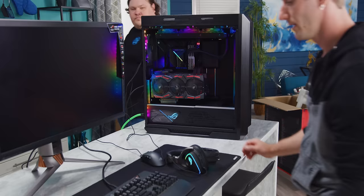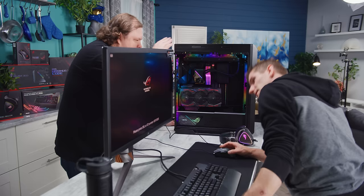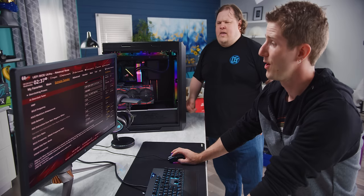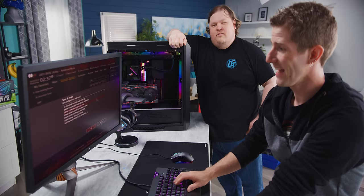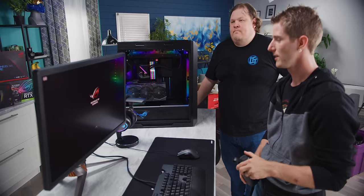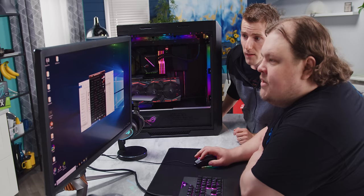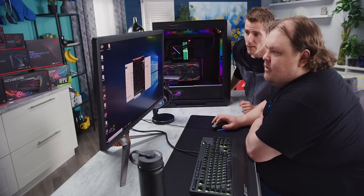Wish me luck — and we're up. The BIOS is prompting us about enhancing system performance with XMP settings. We turn on XMP, multi-core enhancement, and everything else — this is an ROG machine, after all. Firing up GPU-Z: one card is running at 8x PCIe, the other card also at 8x. Everything's fine, we can close up the panels and get our RGB sync running.